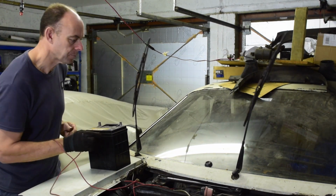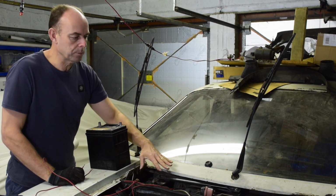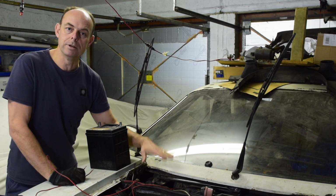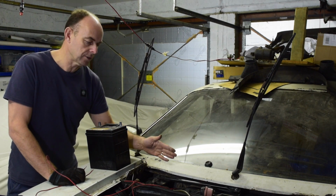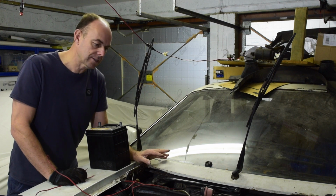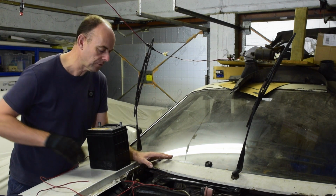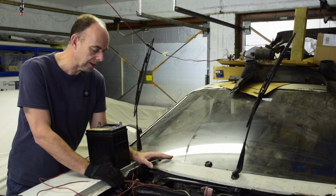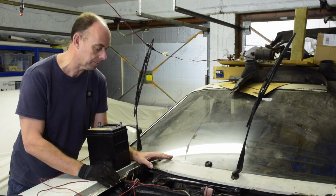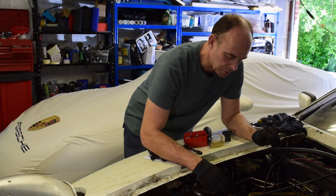Okay, so we know the wiper motor works, so any problems I'm getting now must be the relay or the fuse. I've checked the fuse is fine, so it's kind of pointing to the relay. And knowing that I'm struggling to test it anyway, I think we need a new relay. But I'll wait for any replies on Renlist and we'll just check whether I'm doing it right. It's a frenzy of small jobs at the moment.